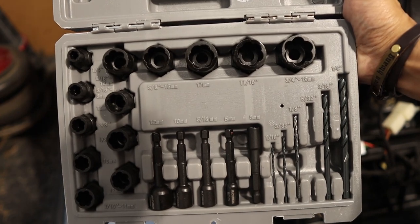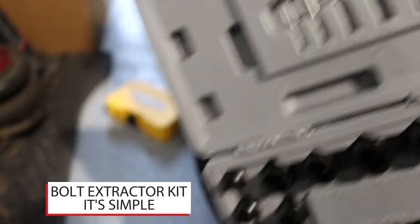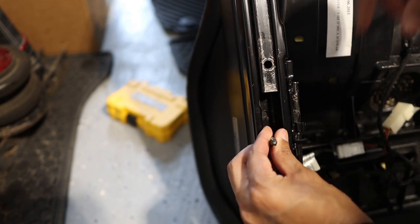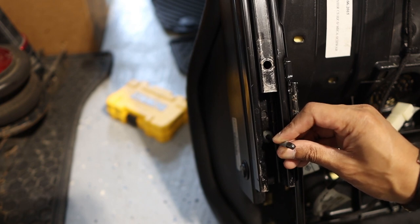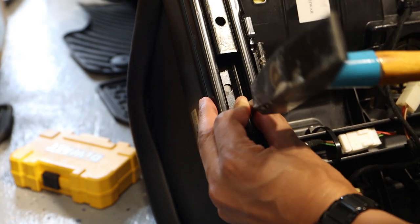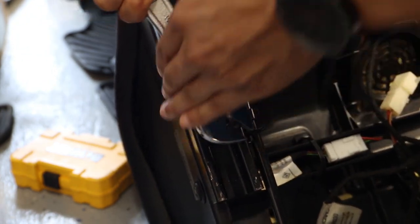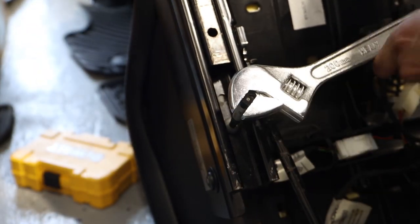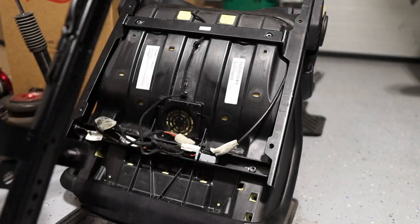These things happen with cars. What you'll need is a bolt extractor kit — this one comes with drill bits and extractor tools. You drill into the bolt, then hammer in the extractor piece corresponding to the bolt size. Once the hole is drilled deep enough, hammer the extractor in and then go counterclockwise — the bolt should come out. We twist counterclockwise and let's just hope it grabs... yes! There we go, success.